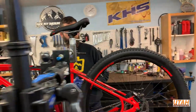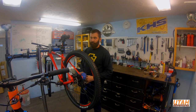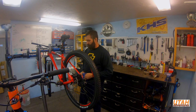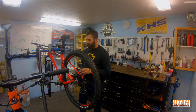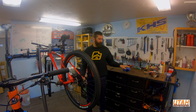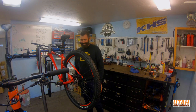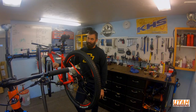This is a new bike so it's already nice and clean, but if you just take a rag and clean things — the chain is all gunky — you can take the chain completely off the bike and soak it in some degreaser, or I typically just wipe it down with a rag and reapply some chain lube. We do a tune-up here to get your bike ready for the spring.